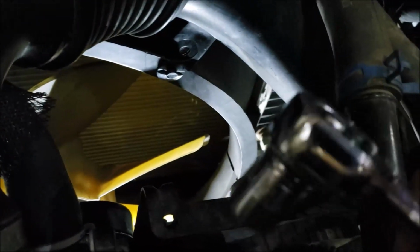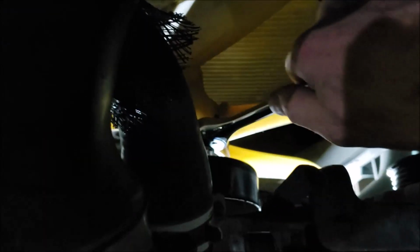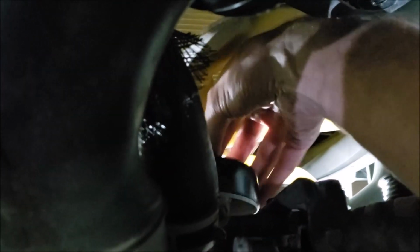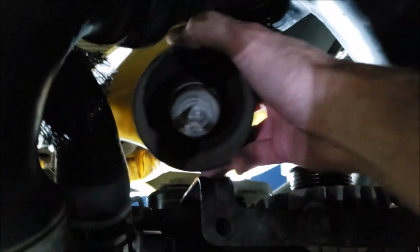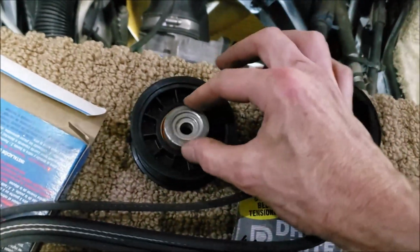Oh, what you'll need is a 15mm socket. Put it right there on that flat idler, the stationary one. It already broke it loose a little bit. It wasn't too bad tight. All right. While you got it off, you can also check the condition of that bearing. Like I said, I keep spare bearings with me because it's a very common bearing. Used in a lot of electric motors and things. Just take your time. Don't drop anything down below. And it's almost off. Here we go. There's our pieces parts. All right. I got that. Put that on there.